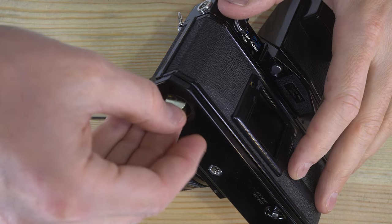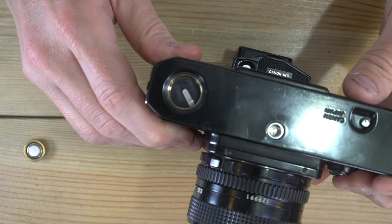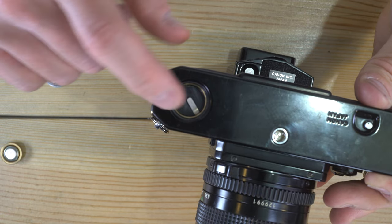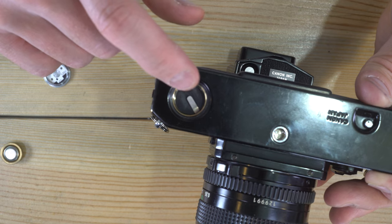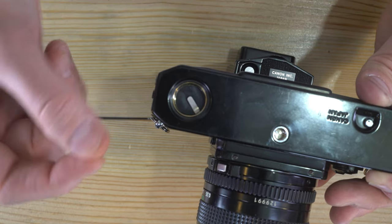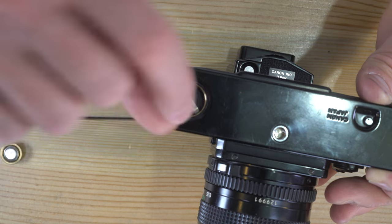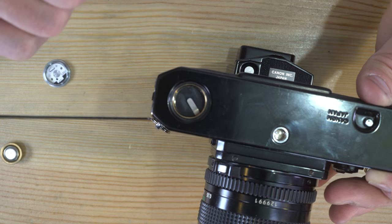Here I have a battery inside of a brass adapter. This is what the inside of a properly clean battery chamber should look like — it should not have any white exploded battery stuff in it. If your battery has exploded and there's white or green minerally gunk inside, you can neutralize that with distilled white vinegar on a cotton swab. Never pour anything into your camera. Clean it out until everything stops foaming, then use isopropyl alcohol on a cotton swab to clean up the threads and contacts.